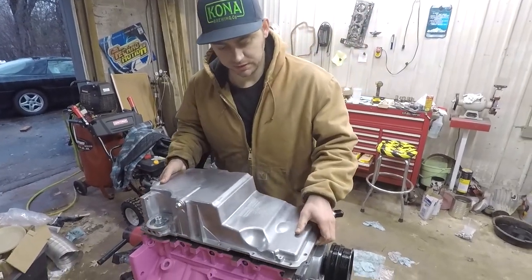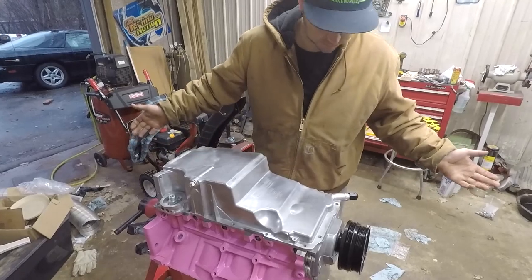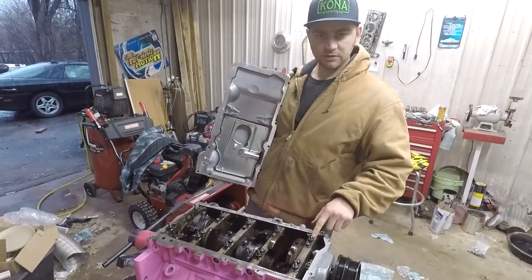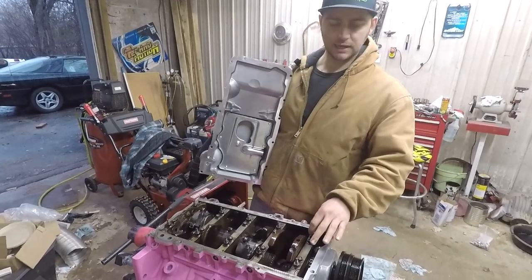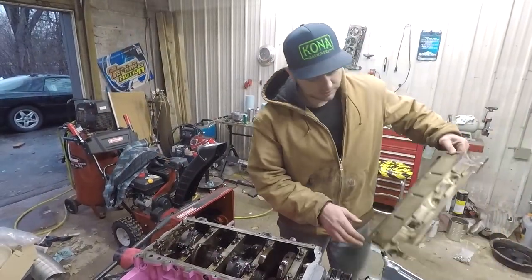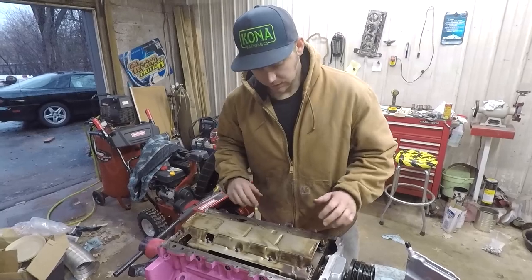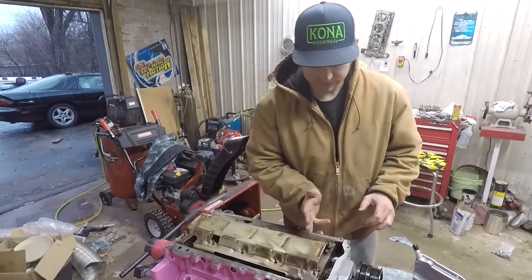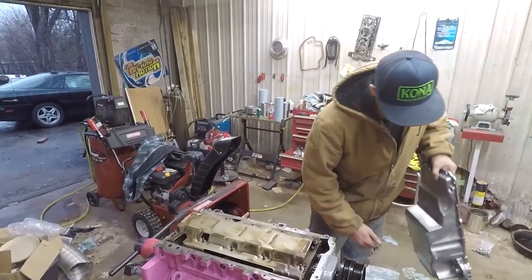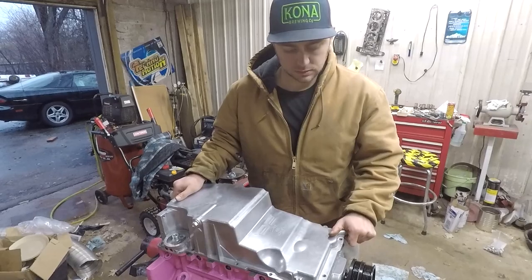I got my turbo drain welded onto the front — it's a dash-10 with a little extension. There's not really a good spot for the F-body oil pan to have a turbo drain, but that'll work. Here is the windage tray. We just have to trim the front because that's where it hits the F-body oil pan, so if we trim that front side it should fit pretty good.